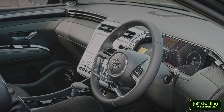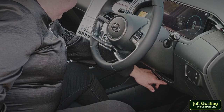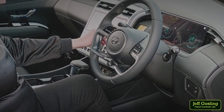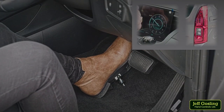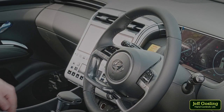It's important to note that when switching between the left and right pedal the ignition must be off. To drive using the left foot accelerator, flick the switch to the left and then turn on the ignition. You can then use the left pedal to accelerate and brake. The right pedal will not be activated and can be used as a footrest if required.